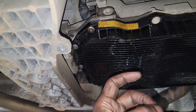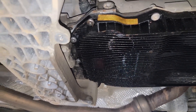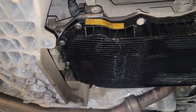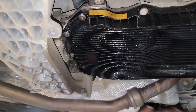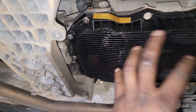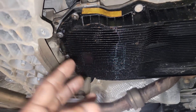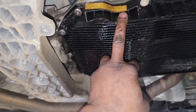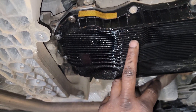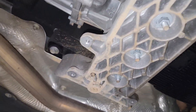Since it's already low on fluid, I have to go through the normal refill procedure, which is based around temperature. Once you get the new pan on, go in with at least four or five quarts, then go through all the gears — or second gear at a certain speed. I need to re-read the procedure, but the fill procedure really matters here simply because you're already low.